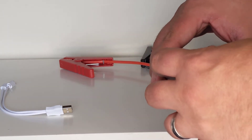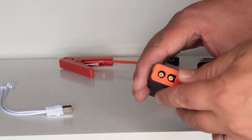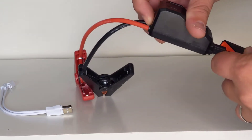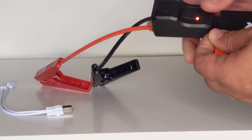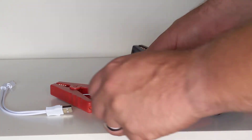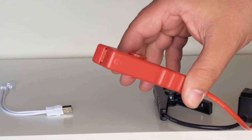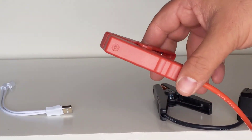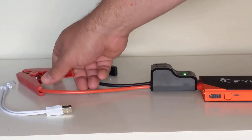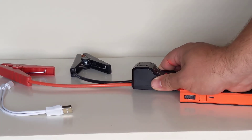In order to charge up your car battery, you open up this little port here — it's a little bit finicky but still reasonably easy to do. Then you have this gigantic plug which socks straight into there. You can see it's going absolutely frantic now and there will be charge running through. Just pop the black one onto your negative and the red one onto your positive poles on your car battery, then sit it there and leave it for a while. You'll notice the battery will start going up and it will eventually have repaired that battery.